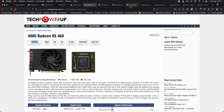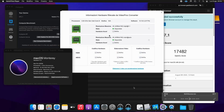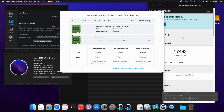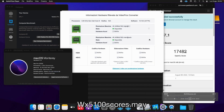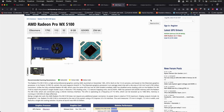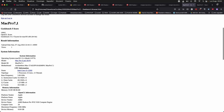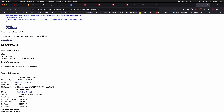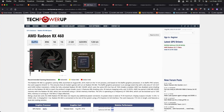When you test the WX 5100 you get full encoding support. This is the OpenCL score of this card — it's a very good score. Here we have the Geekbench 5 results. The WX 5100 scores very well, while the RX 460's Geekbench score is around 30% lower, even though both cards draw the same power because they are both powered entirely by the PCI Express slot.